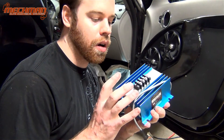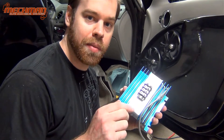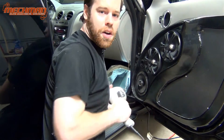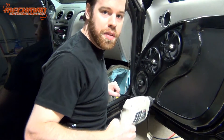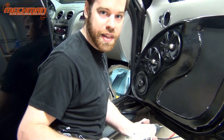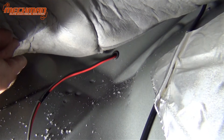These regulators are designed to be mounted in the engine compartment on the firewall, but I'm going to mount it on the inside — it's just easier for what I want to do. I have a unibit here, which is very good at getting through metal. I'll start with the tip of the drill and do one small hole, and once I do that I'll be able to shine a light through, go on the other side, and make sure that hole is in a free and clear spot. Once I verify that it is, I'll make the hole to the correct size needed to mount a grommet and run the wire through.